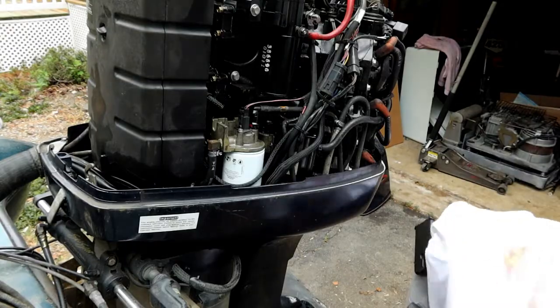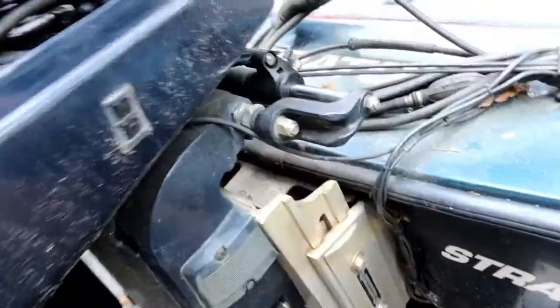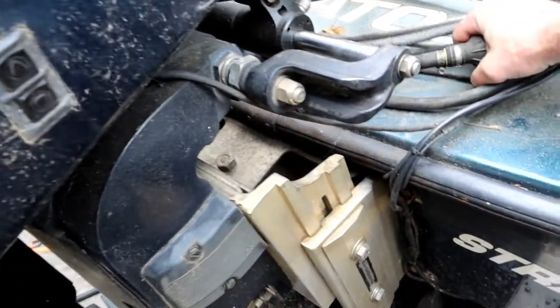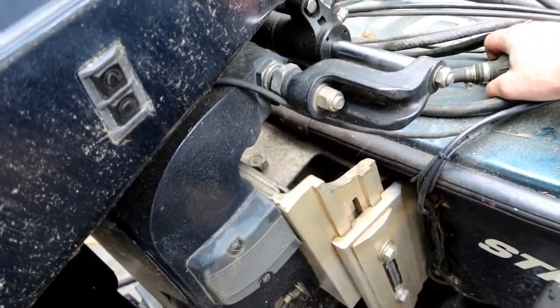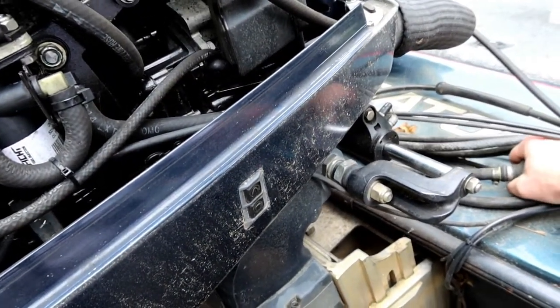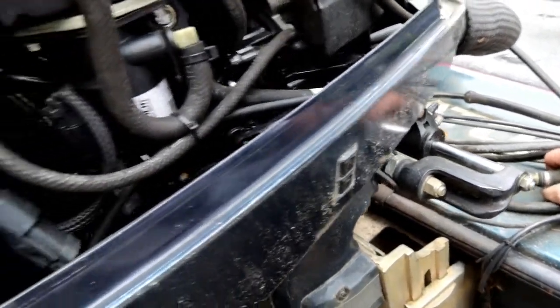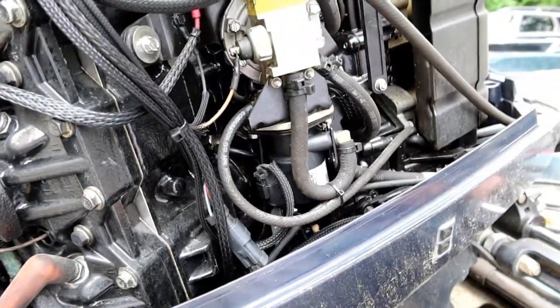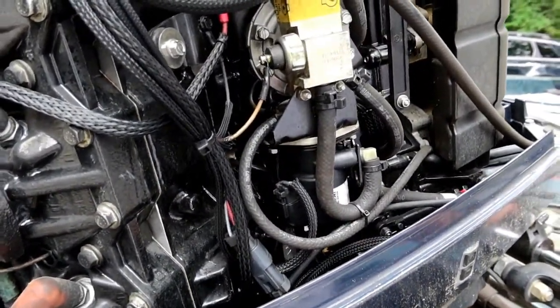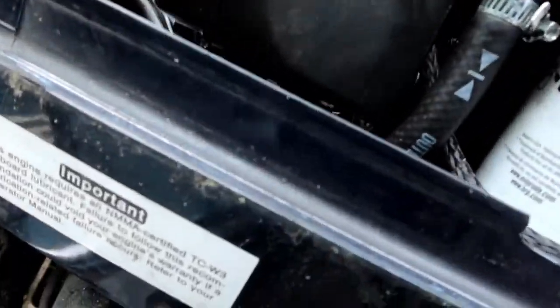But try to fire it up. Okay, make sure you get a good water supply to the lower unit. Pump up our check valve, get the gas flowing. Sounds like I hear air escaping. Make sure I don't see any fuel spraying anywhere. Primer bulb is rigid.